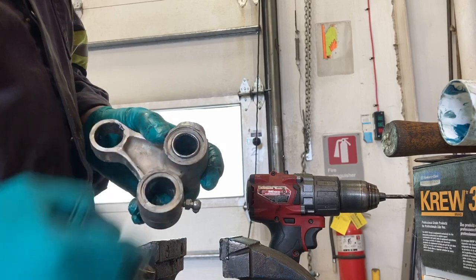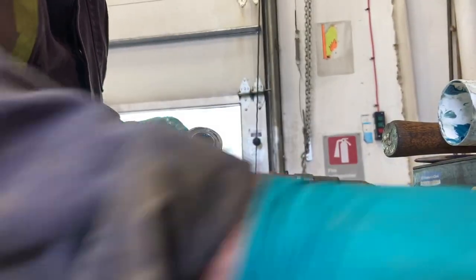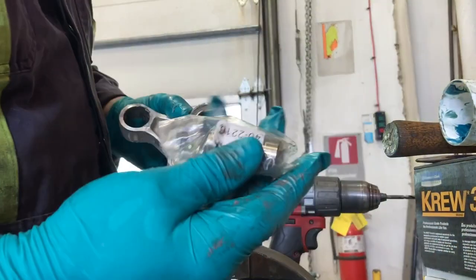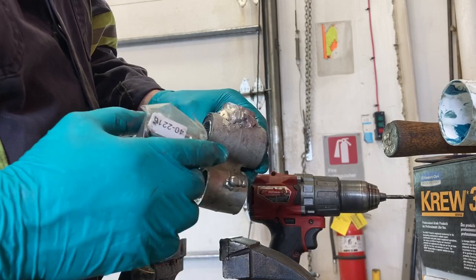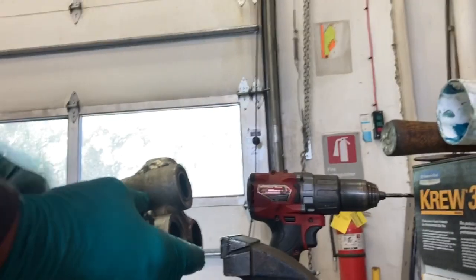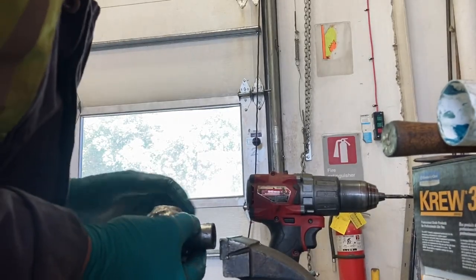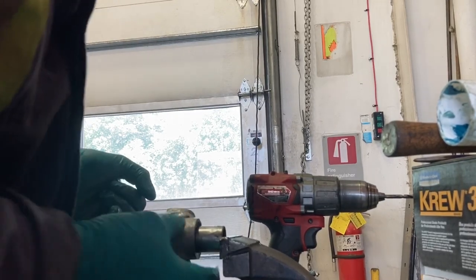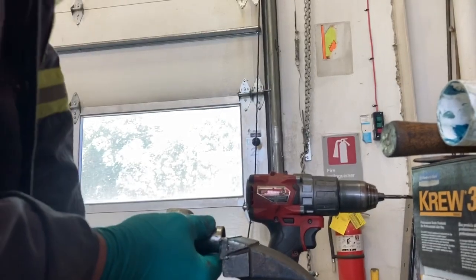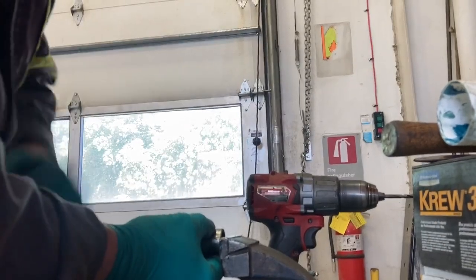On this particular one there's lots of room inside between the bearings, but you don't want to go in too far because of your inside bushing — you want to make sure that inside bushing is riding on the bearing surface and isn't too long or too short; it needs to be centered. I'm going to do the same thing with my 3/4-inch socket here — it's just the right size. Make sure when you do this that your socket's lined up and it's not going to catch the edge of your aluminum and bend or mar it. You'll feel that right away if it starts to catch.